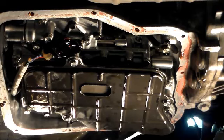So, 2011 Subaru Outback with the CVT Lineartronic transmission — we had code P2764, a low circuit on the lock-up duty solenoid. We switched out the valve body with a new one. I'm going to have the guys put the pan back in, refill with new Subaru-specific fluid, and then we'll need to get this learned — probably drive it to the dealer. Thanks for watching, guys, and have a great day.